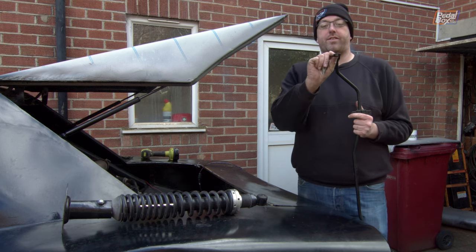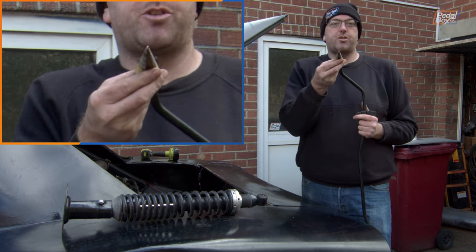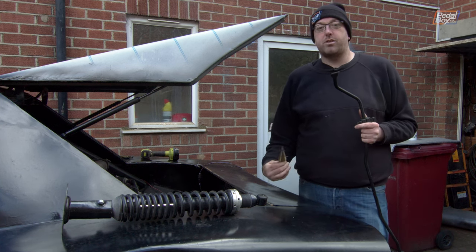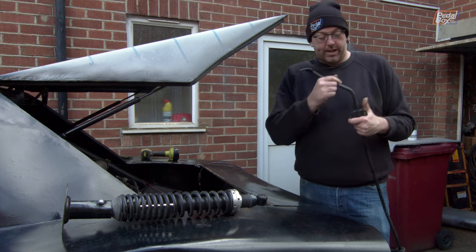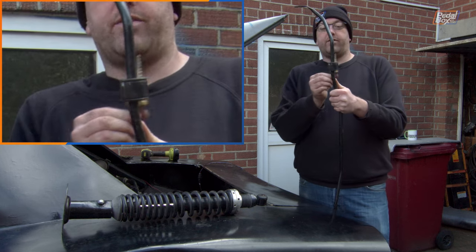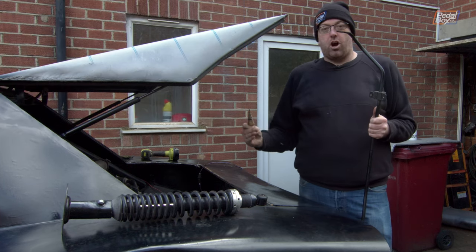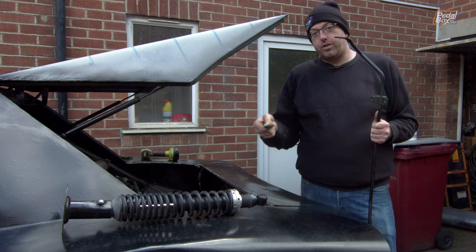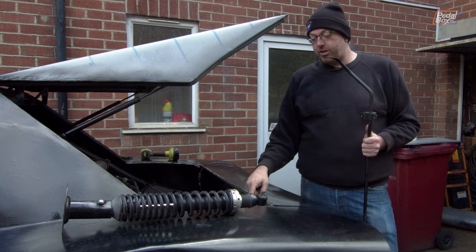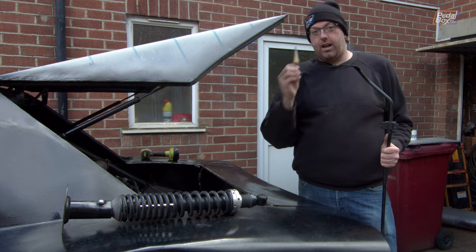With the exhaust retrieved, we just need to drill the two holes in our enclosure panels on the side. We know how big the ARB is and we have a nice big 30mm Christmas tree cutter - the ARB is about 26-ish mm but we're going to go full 30 so we have enough space to waggle it around. To find where the hole goes we work off the mounting plate and the cross beam, putting it about an eighth of an inch off the backing edge. We're drilling at a 45 degree angle because that's the angle of the aluminium plate.